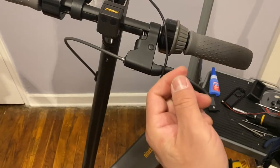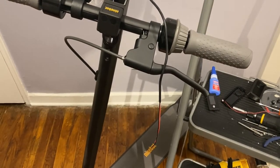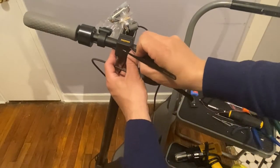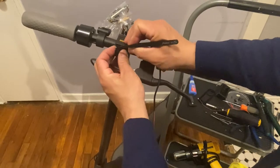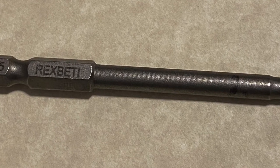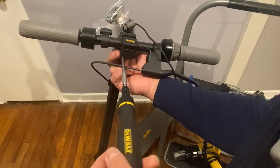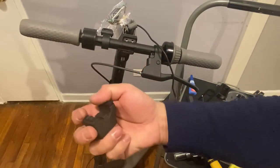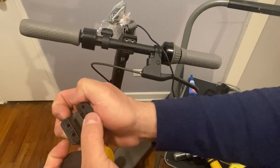We're going to get the screws first out to make the connections. We're going to use something pointy to catch that rubber — those are called seals for the screws so that they prevent water going into the scooter. There's a bunch of secure seals in there, so we want to make sure that we don't lose them. There are two only in that part. For this, we're going to use the Torx number 25. Make sure that the seals in this part don't come off — it's easy to put them back because once they come off, it'll give you a hard time to put them back in position. That's what prevents water from coming in.